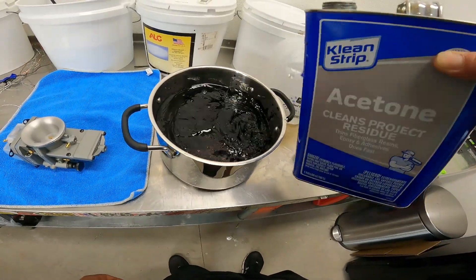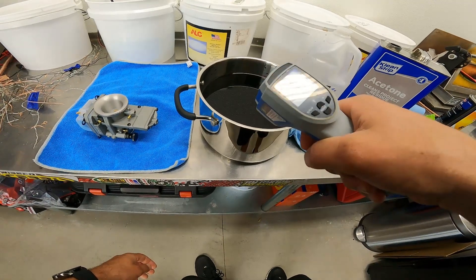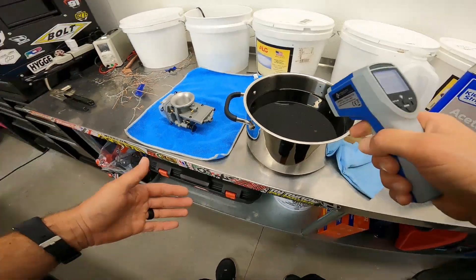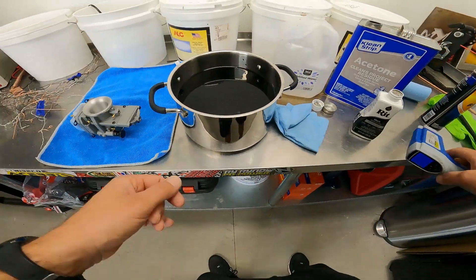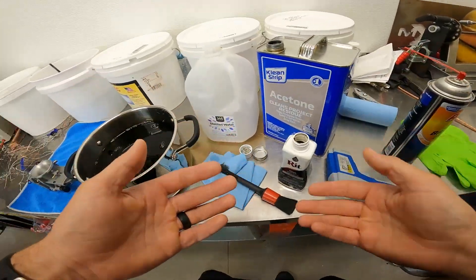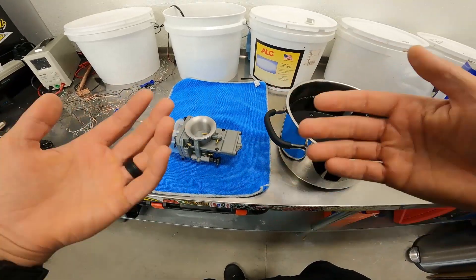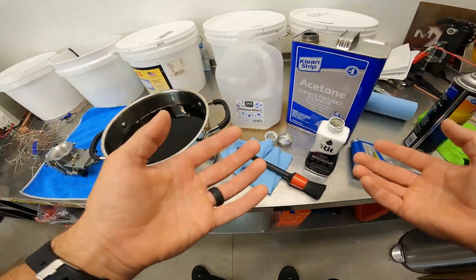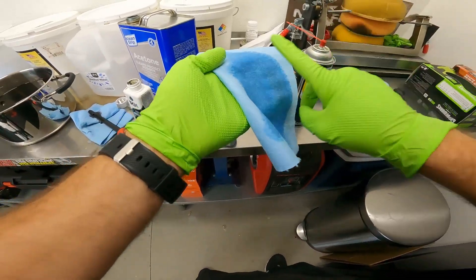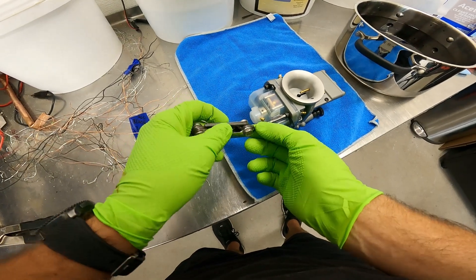About 10% acetone — there you go, close enough. Before I heat this up, let's just give it a shot — it's already 90 degrees outside. The whole idea behind the acetone is to get the pores of the plastic to open up so the part absorbs more of the dye. We'll get that stirred up and then submerge the bowl.